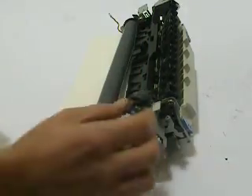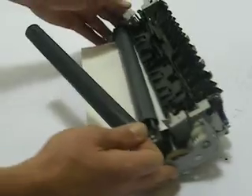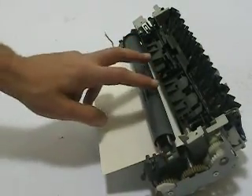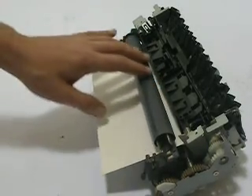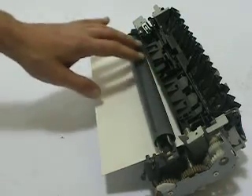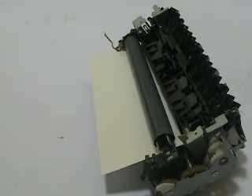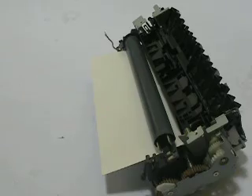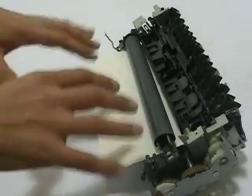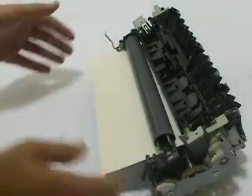We can pull off the collar — it pulls right off — and set it to the side. Right now you can take a look at the sleeve. You might have some print quality defects that the toner cartridge didn't take care of. You remove the fuser, inspect it, and notice that this Teflon-coated sleeve — like the Teflon on your pans at home — wears off after maybe 80,000 or 150,000 pages, or maybe you ran a lot of envelopes through your machine, which put lines on the fuser that now show on the paper. If your printer is in a 50 error, this is not the repair for you, but if you're dealing with print quality issues and you've inspected the fuser, this is a great repair.